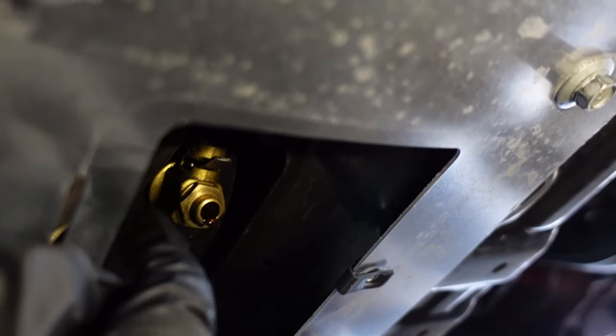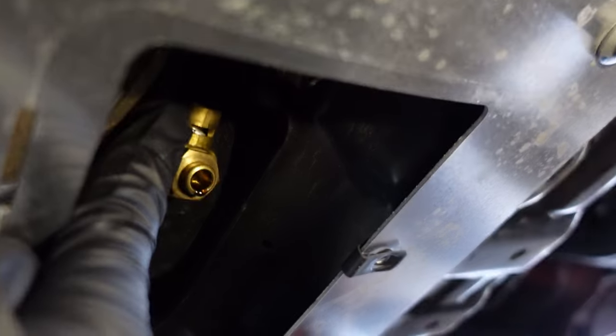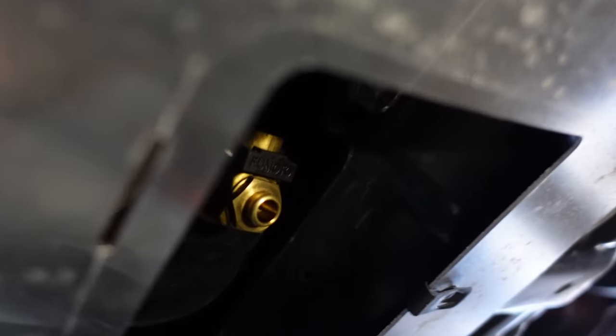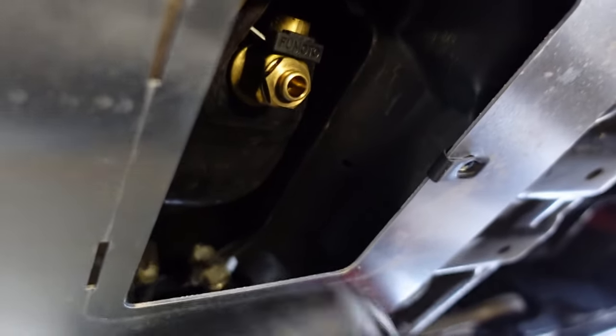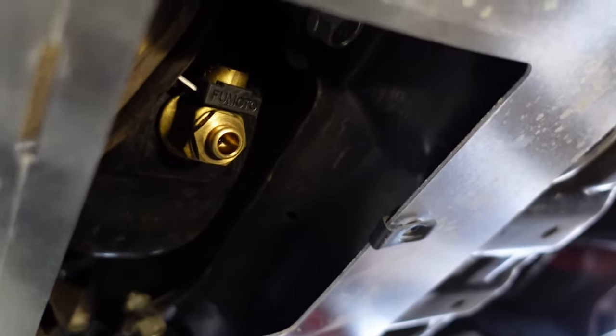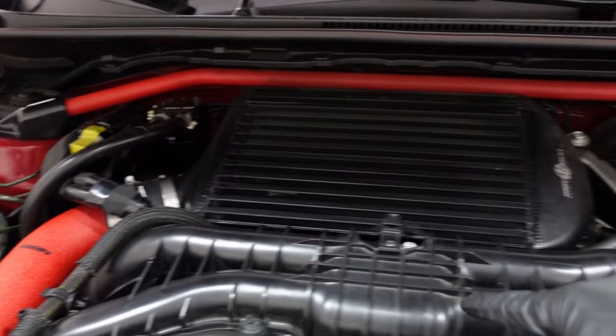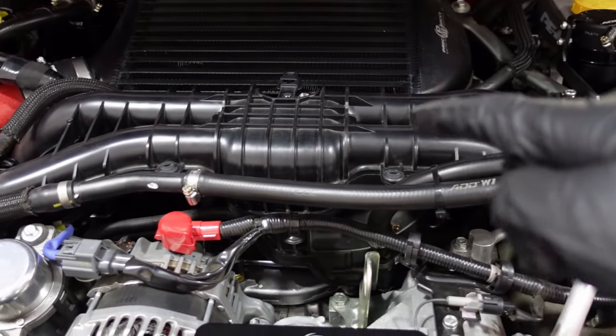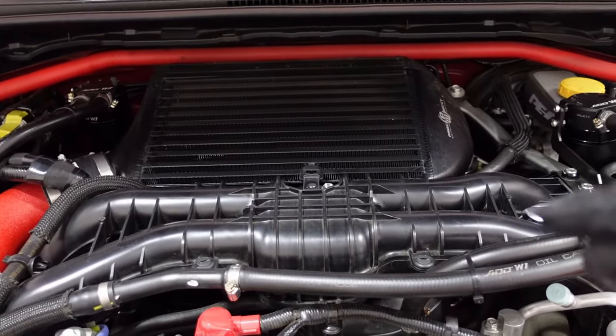Closing this lever is the same as putting back your oil drain plug, so let's go ahead and do that — it is now closed. Give it a quick wipe and it's good to go; it simply locks right back in place. No tools required, aside from removing this cover if you have an aftermarket skid plate. This is also a good time to clean out your catch cans if you have any. I'll link that video here, and I also made a video about cleaning your MAF and MAP sensor — good time to take care of those things right now.